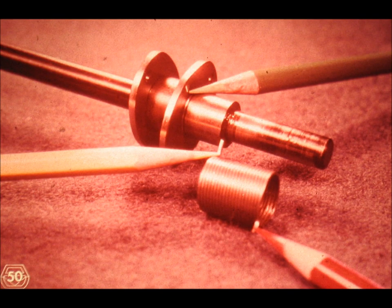If your cycle shaft is of a recent serial number machine, the minus 5 cam will be marked with a small scribe line, as indicated by the green pencil. This scribe line is used as a reference mark for the preliminary mounting or assembling of the cycle clutch spring. The lug indicated by the yellow pencil is to be aligned with this mark. Notice that the lug indicated by the yellow pencil is substantially longer than the lug indicated by the red pencil. If your cycle shaft cam does not have this scribe mark, simply line up the long lug of the cycle clutch spring with one of the lowest spots of the minus 5 cam. The lug indicated by the red pencil fits into the window on the sleeve. Under the green pencil, we have the cycle shaft arbor, or the driven arbor of the cycle clutch.